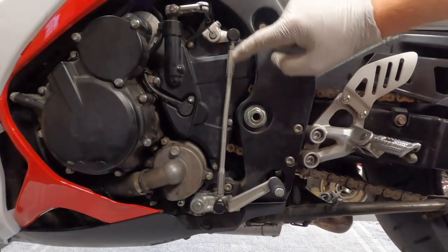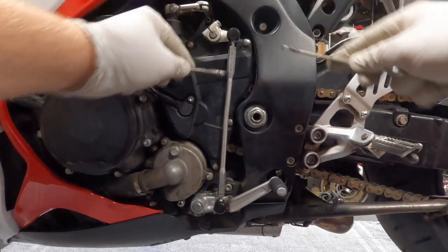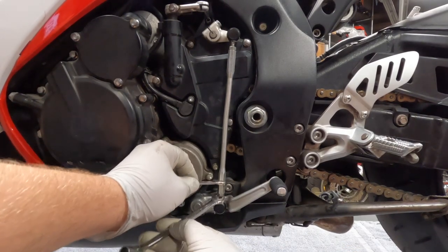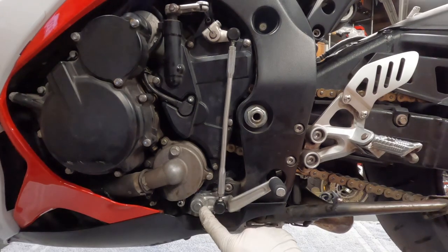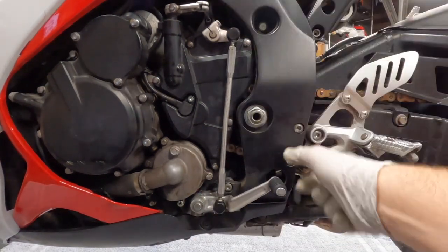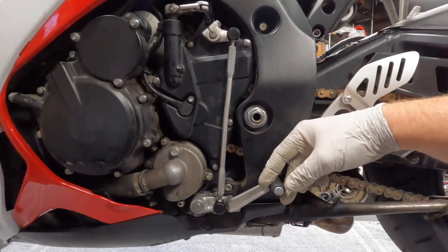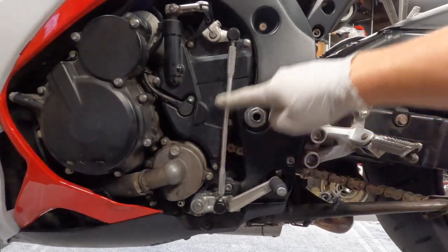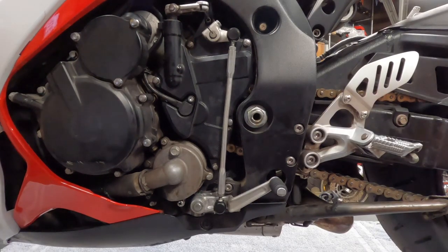Now that I've got the shifter where I like it, I'm going to re-tighten these two lock nuts. As you can see, they both tighten the same way even though one is upside down from the other. So now that's nice and tight — we got 90 degrees, the shifter where we like it, the circlip installed, and the pinch bolt tightened down. Everything is nice and solid and not going to fall off. I hope this helped you. I would encourage you to go adjust, clean, and lube your shifter. At the very least, I hope you learned how to adjust your shifter so that ergonomically the bike is adjusted to you the way you like it. Thanks for watching — don't forget to subscribe and comment below if you have any questions.